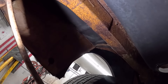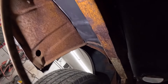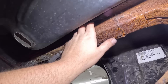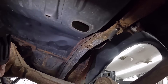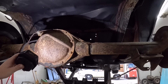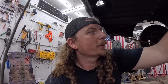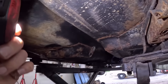The other thing I noticed — this side's actually not too bad. He put rear frame pieces on and plated it, so this side actually did a decent job. This side, less of a good job — so it was either the first one or the Friday one. We'll clean that up, maybe just run a bead of weld down there. I think that's pretty solid, pretty solid car, for what these things are. We'll re-weld that, fix up that little section under there, a little bit of seam sealer. And really, it's ready for undercoat and paint as far as I'm concerned. Up in here I don't see a whole lot of issues.